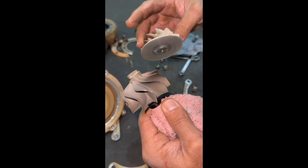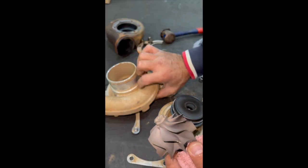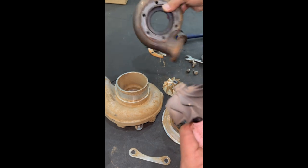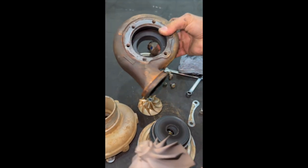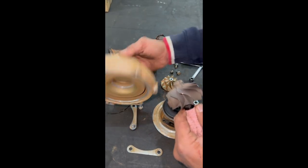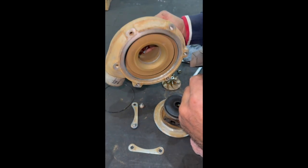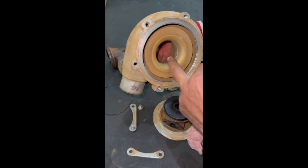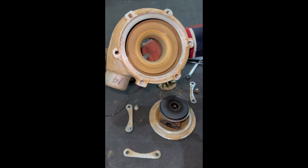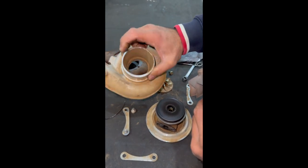I thought I'd share this with you guys and give a little more detail about what this poor turbocharger went through. We'll obviously rebuild this turbo for the client. The turbine housing is still intact and can be reused — that's not an issue. The compressor housing is still within tolerance; although it doesn't look like it, it looks a lot worse than it actually is. We can just put this onto the CNC and machine an additional 0.1 millimeter clearance in there, and that will clean that surface up.